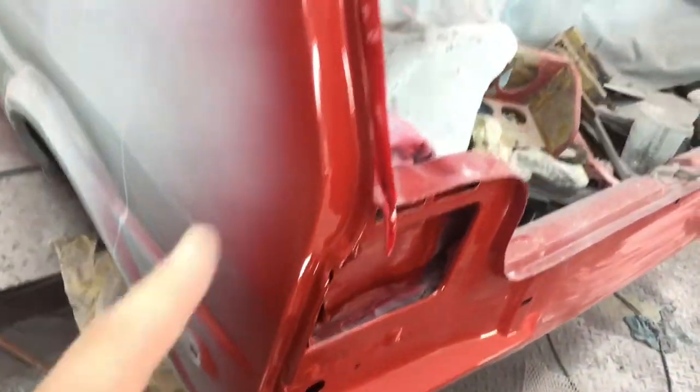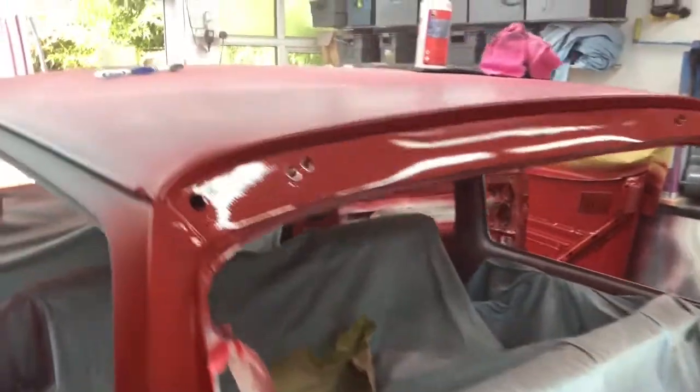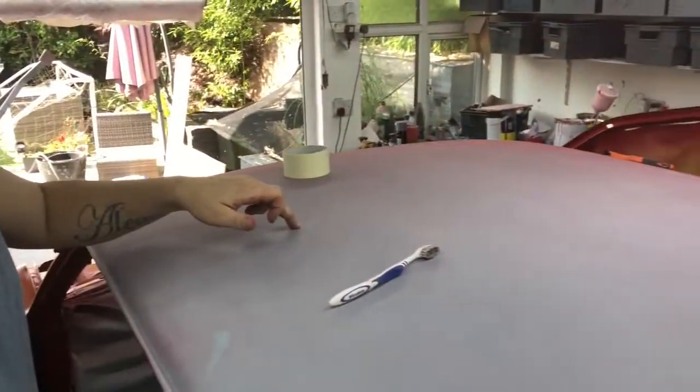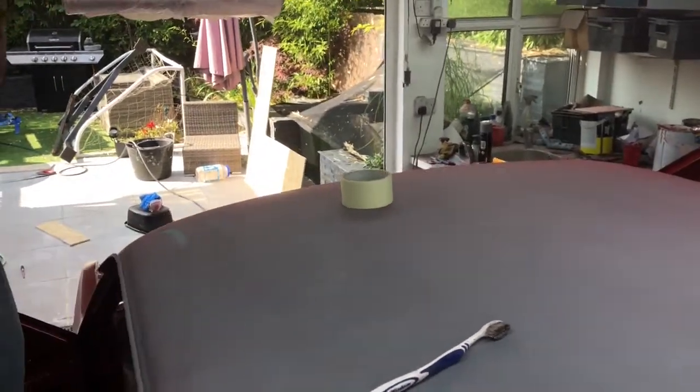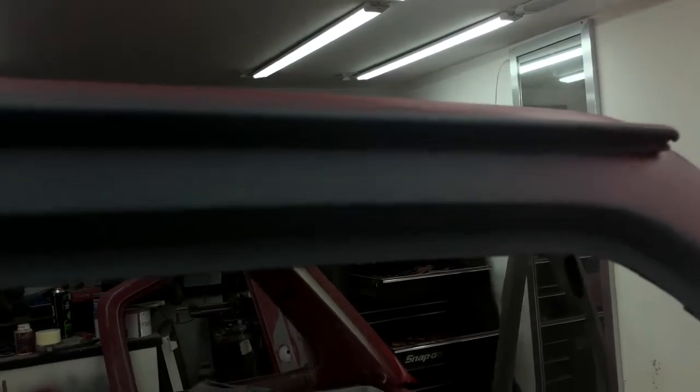So the idea is I've got to this stage — all these edges will be flatted back with 800 grit. 800 grit the roof again. Obviously we've got this side where we had the dry patch on the door — totally gone now, give that two more coats. There's a minor drip there and I've got a little drip there as well. But I have intentionally got a load of paint on this. It doesn't appear to have cracked again, but I'm going to leave that about a week because I don't trust it, and I still need to seam seal these edges. I did rake out and re-seam seal there — I don't know if you can see — the white, because that's been raked and that's all seam sealed.